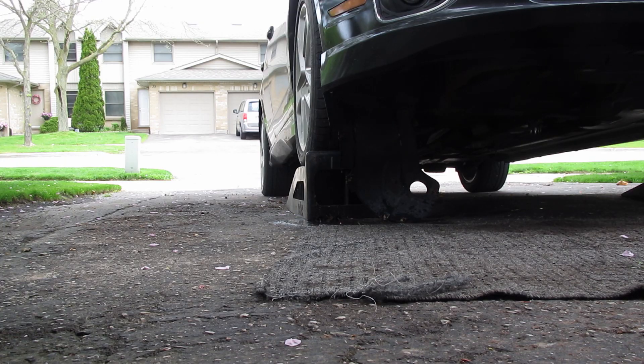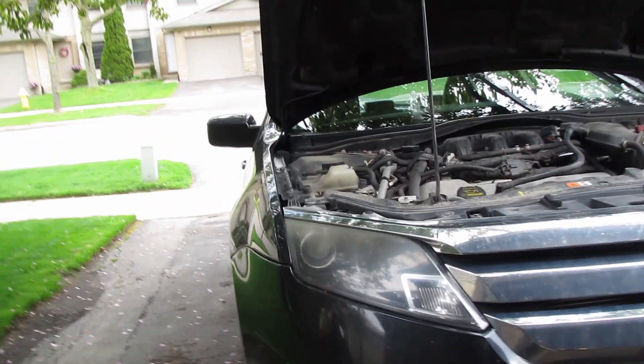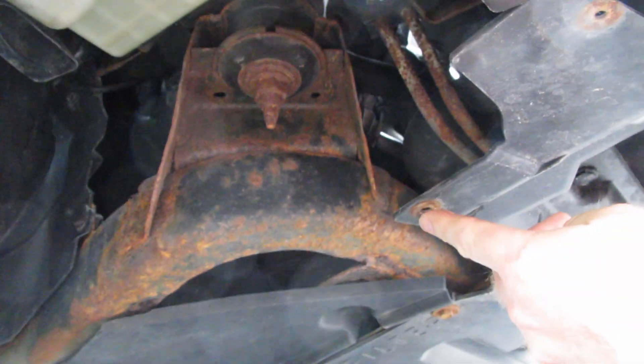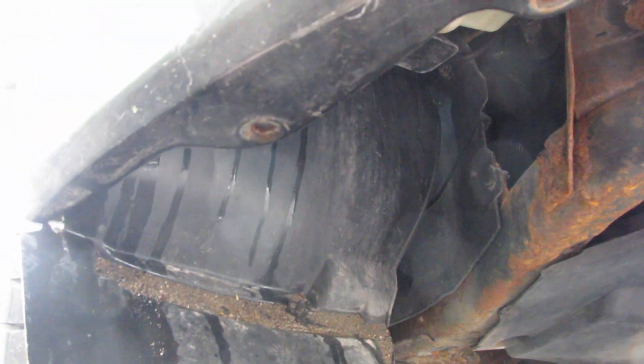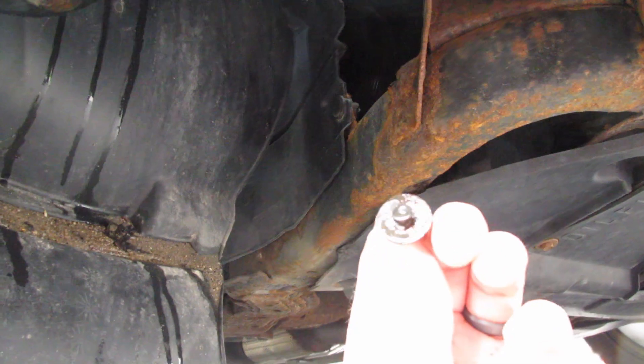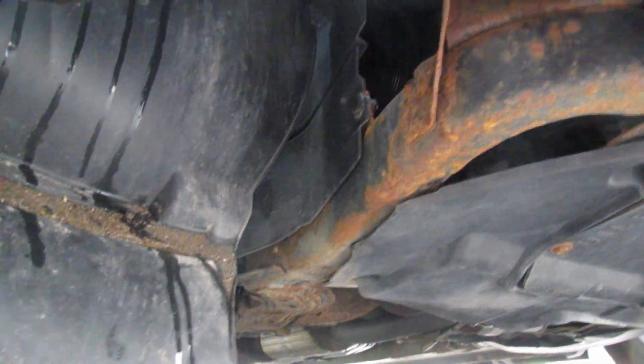You can see it a little bit better because the shroud is off, so it's dripping out even faster. Underneath here there are seven 7mm bolts that just need to come out. I pulled the shroud out of the way and that gives you full access — this is the tank, and there's the connection to the pump, and this is the pump here.